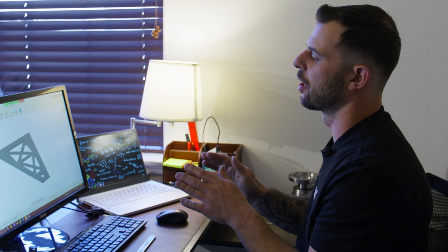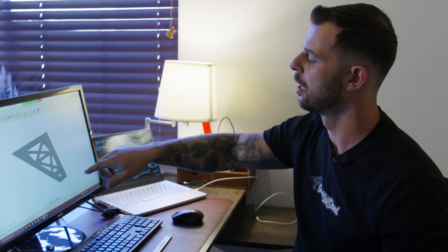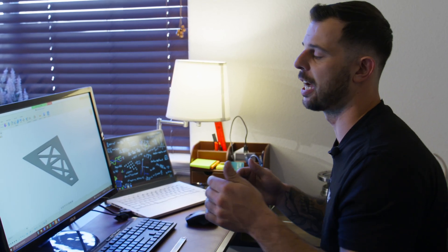I'm going to spend a little bit more time finalizing this design and adding some clearance holes and a little bit of shape and form — I want it to have some style. When I get done I'll show you what I came up with. I added some clearance holes and now I want to double check that this design is exactly where I want it — most importantly from that center of the heim to the center of the tubing. We're going to create a DXF, take it to the CO2 laser in my shop, cut it out in wood, bolt it on physically to double check in the car, and then we'll add all the bending features and send it to SendCutSend.